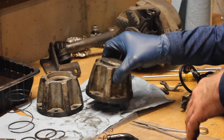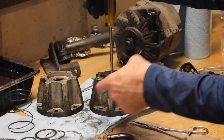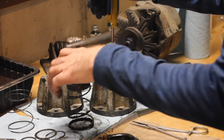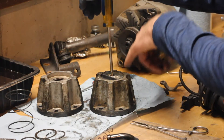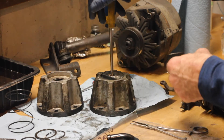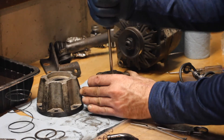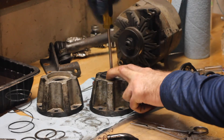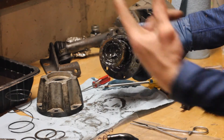Something to take into consideration when refurbishing this part: when you're taking out the screw, realize you've got a spring that big compressed behind it, and the only thing holding it in place is that screw. Have it pointing down into some kind of surface, because it will rocket all the way across — and you definitely don't want to be looking at it because it's going to hit you in the face with a lot of force. Once you release that screw, wait for it — hear that? The thing pops out and it's been released.